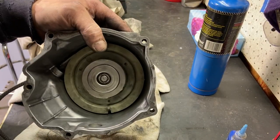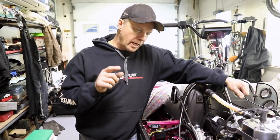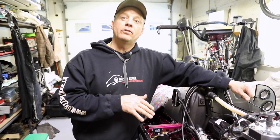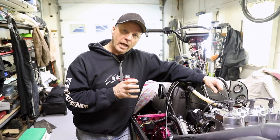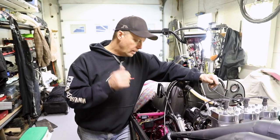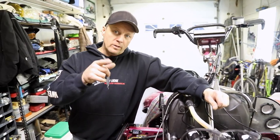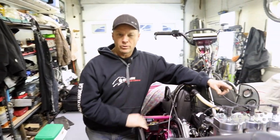Good as new — then we'll go put it back on. So I got everything back together. One thing I can say is if your rewind is acting up a bit, you may want to take it off and inspect it, because you never know what's in there. I had one come apart on me and totally disintegrate the stator on a sled — that got a little costly. So if you sense that your rewind is hanging up, take it apart and inspect it. I got everything back together here, pulled it, starts, rewind works awesome. If you found this helpful, make sure you subscribe and click on that little bell notification to get all of our updated videos — thanks for tuning in.